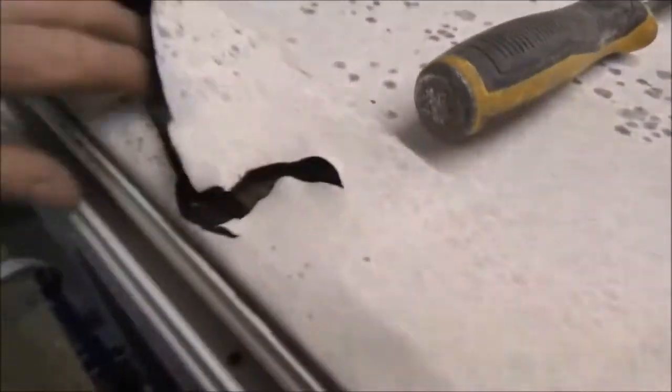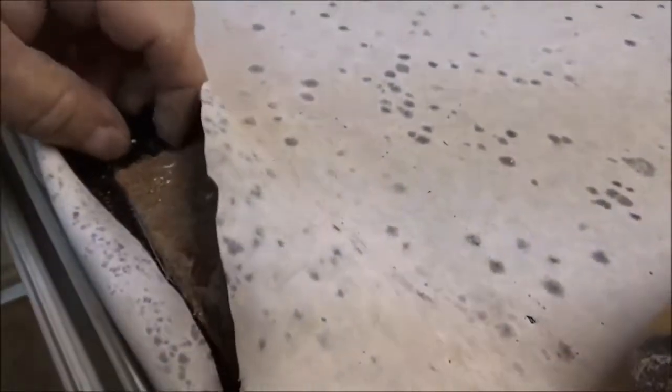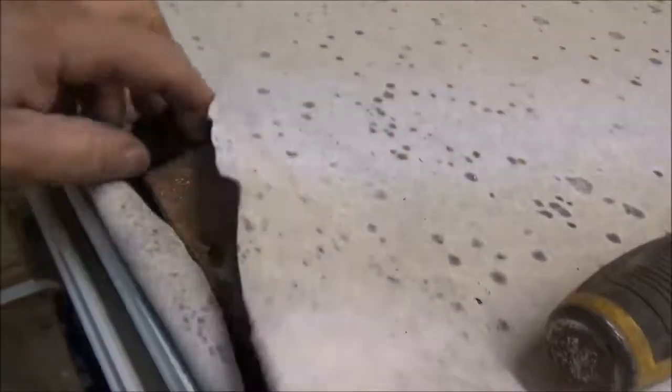You can just tear this right apart. That's all they did. It's just tape right in there. There's some more right here, you can see it. That just failed and fell down in there. We're going to put a whole buffer strip on there, protective strips, which will be the same product. It'll be a 60 mil protective strip. We cut it out of the same roll. The rolls are 10 foot wide. This camper is probably about 99 or 100.